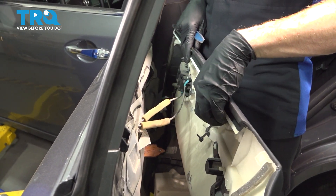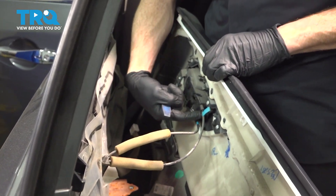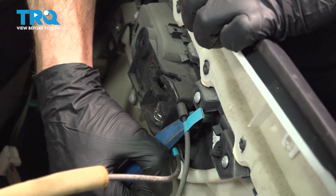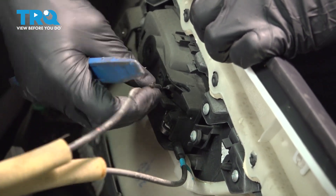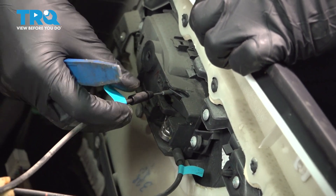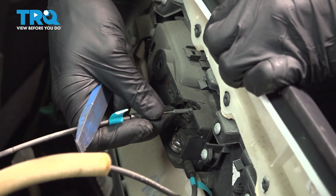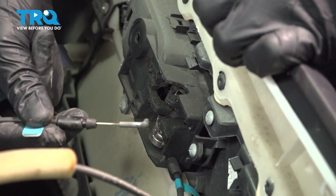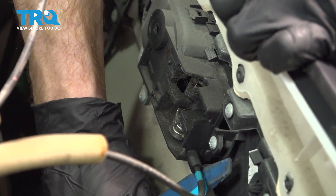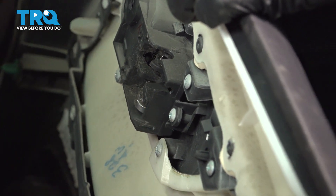Typically you could just trim it yourself — it looks like somebody already did that. We'll follow these cables to where they connect onto the inside door handle. For each one of these cables, we're going to have to separate it from the door handle. You can take hold of it by hand or use your plastic trim tool and gently pry it out of place. The cable has a small groove and the inside door handle has an area that fits into that groove — that's what holds it in place. Take hold of that cable, swing it into position, and lift it straight up and out. Give that cable a quick inspection and set it aside. We'll do the same to the lower cable — lift it up and out of place, a quick inspection, and remove the door panel.